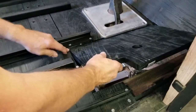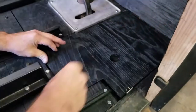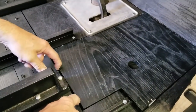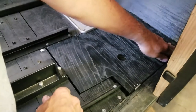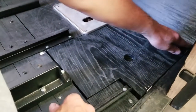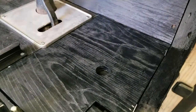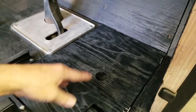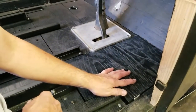You have to keep it towards the rear. Use the finger hole, push it down, and now push it forward. And once it's pushed forward, you see there's a gap in the floor, but there's no gap showing you the road down below, so we're not going to get a bunch of dirt and dust through there. The little springs are holding it in place on the side. It's up under the floorboard, and all of that was done with everything in place. So yes, it's a modification of what Kissel had, but it at least makes it usable so you can get to your battery without taking the car apart completely.